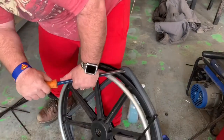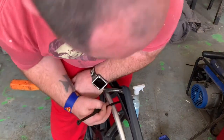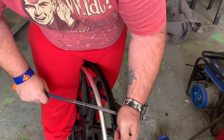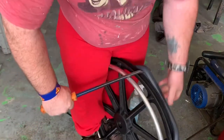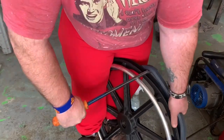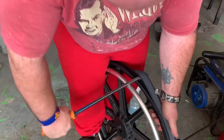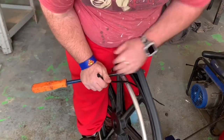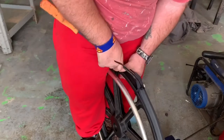You can see I changed clothes — I was sweating like a stuffed pig in summer. But here we go again. Make sure you keep a hold of that pry bar — if you let go that thing hurts. I feed through the zip tie and I keep binding on there. After you get it on there far enough, you can actually take that zip tie and slide it up onto the rubber a little bit further. Once you see it's kind of a pain to get on there, just get another zip tie — but sliding it can save some zip ties until you get to the next spoke.